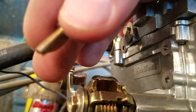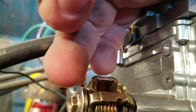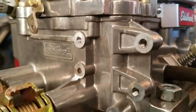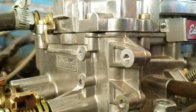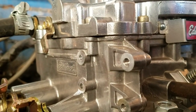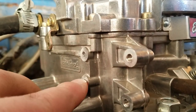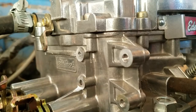Whether you use a kit or an old one off of another carburetor, you'll have these kinds of screws. They are not completely round — they are called self-tapping screws. Once you drive those screws in, it taps the inside of the hole so that it'll accept the thread. You only need those three to put the unit on — you do not need to tap the fourth one.